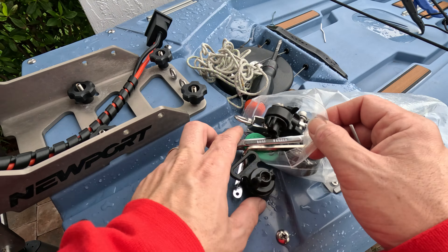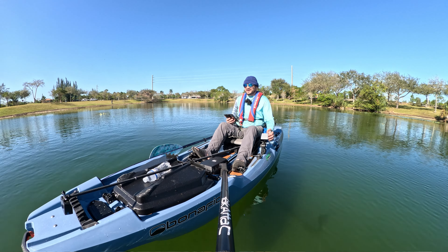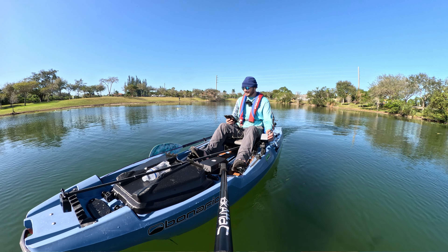One of the cool things about a kayak like this is hands-free fishing — this is truly hands-free fishing because you just set the speed you want and then you can cover the waters you want, and you steer with your feet. We're finally back here and I think I've got the motor running very well — it's always time to do a complete water demo. What I was doing right there was clearing the prop because it had a lot of vegetation — I could tell because the motor was making that sound.